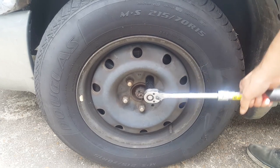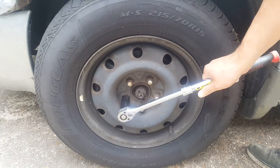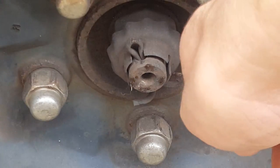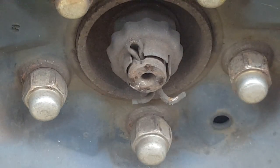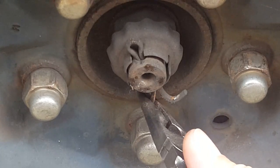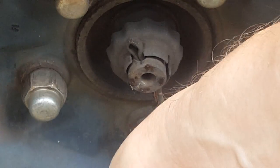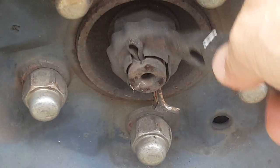I've got some wheel covers missing — I'm going to have to hunt down some wheel covers for it. Also, before we go to lifting this up, we're going to want to remove this cotter pin and the retaining nut that goes over the axle nut. So I'm going to straighten this out — it's actually a pretty tough, sturdy cotter pin — so I'll go ahead and straighten that out and knock this through.